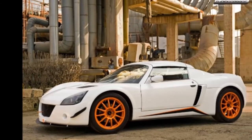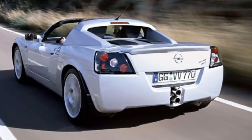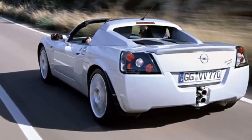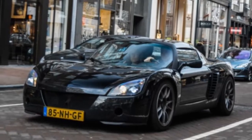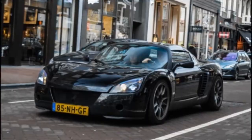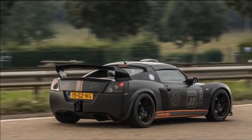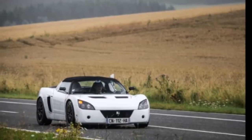The body is made of bonded composite panels with fiberglass reinforcements. The Speedster package is a tidy one: 149 inches long overall on the 91.7-inch wheelbase, 67.2 inches wide and only 44 inches tall, with a front track of 57 inches and rear track of 58.6 inches. It rides on Bridgestone Potenza P175/55 R17 fronts and P225/45 R17 rears — not too tall, not too fat, just right for this application.